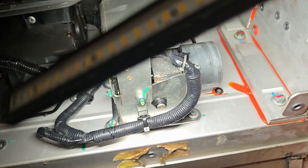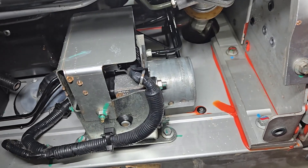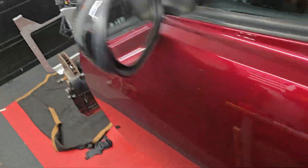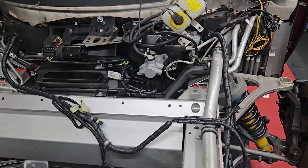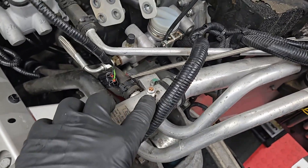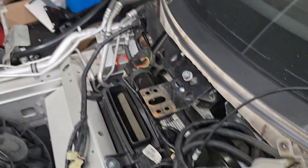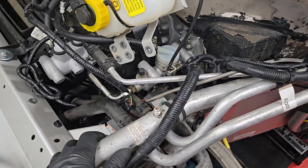And that's why you leak test. Looks like I'm getting a drip from the heater core. Got to check those clamps. All right — I'm currently going for broke, 15 PSI charge now, and no more leaks. I'm going to make sure of it before I put this all back together, because I don't want to have to get back in here after I put the front clamshell on. Since this is all under pressure now at 15 PSI, I'm going to try to power bleed these. Get the bucket under there, push down — 15 PSI of air is going to be pushing behind that — and I'm going to try to get as much air out of the system as I can. Keep doing that: charging it, bleeding it, refilling the overflow.